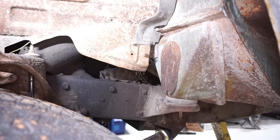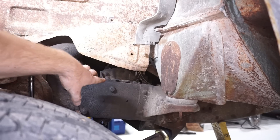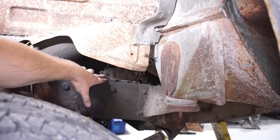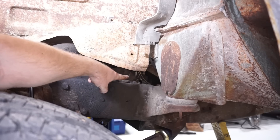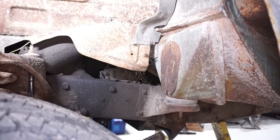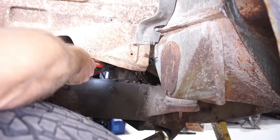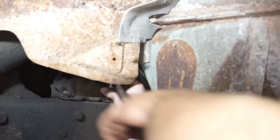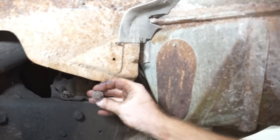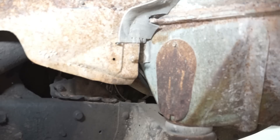Looking in over the driver's side tire into the frame rail — this is the top side mount of the clutch pivot point bracket. These two 9/16ths bolts here are going to come up off of the frame and this whole bracket will fall out of the way. The nice part is you can just lay the tire on the ground and with the front of the truck up on jack stands, the suspension typically falls down enough to get access. That bolt has seen better days, but now this bracket should just flop out of the way and won't be in the way to pull the motor up out of there.